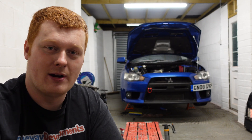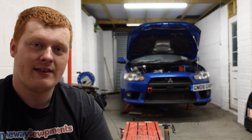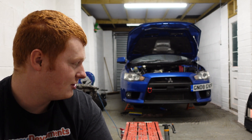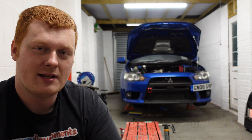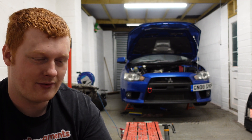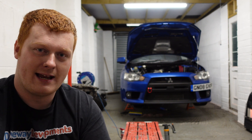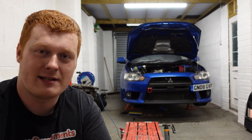It's not just a safety upgrade either - those springs mean you can actually rev the car higher now, because the springs are more powerful and can push the valve back faster, which is actually the limiting thing when it comes to revving an Evo 10 safely. That, combined with the balanced con-rods, the changed power profile of the upgraded cams, and the big turbo, we're really supporting the build to allow it to rev that little bit further. Factory is around 7,500-7,700 RPM, and technically we could run 8,500, but I'll probably run about 8,000-8,200 - giving us an extra 500 RPM of power band to play with.